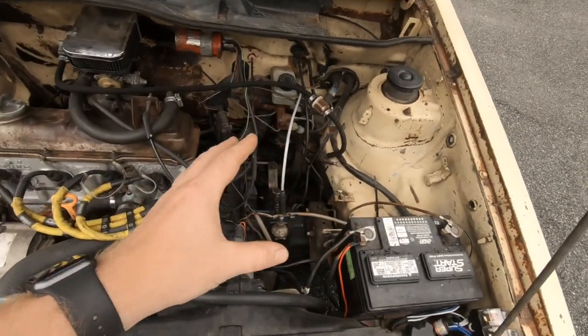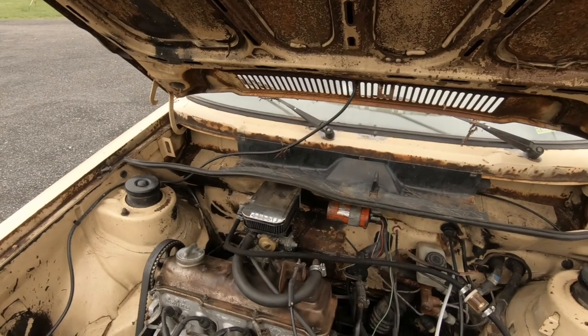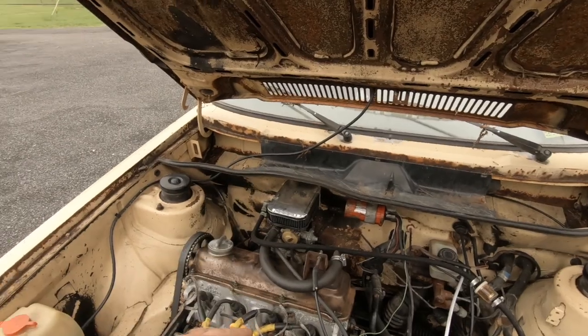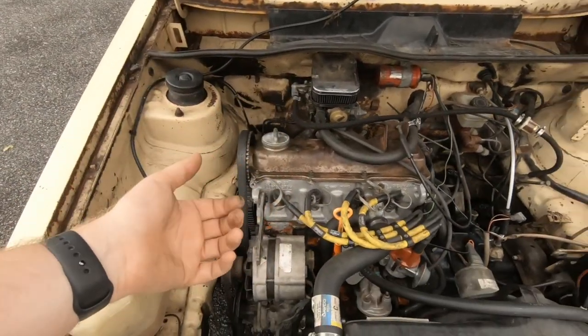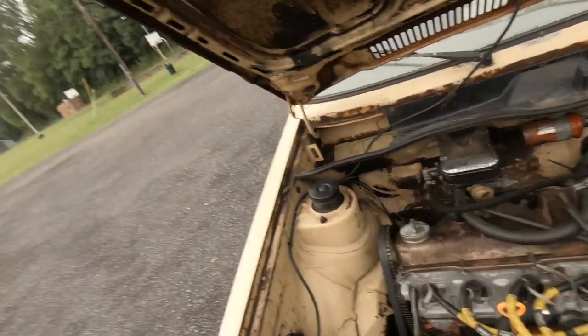Unfortunately, we don't have a CIS system on here, but we should still be able to run through it. Before we dive into exactly what you need to do to convert from CIS to carb, the things that will make your life a whole lot easier: if you're not buying just a single 32-36 Weber off the shelf and bolting it on, you're going to need to do some tuning — especially if you're buying a used, unknown-condition carburetor or going to rebuild it. Get yourself a wideband gauge, air-to-fuel ratio gauge. Otherwise, the only other way to tune these is via the butt dyno, or taking the spark plugs out and checking how they're burning, then taking it out for joyrides 57 times in a row up and down the neighborhood.